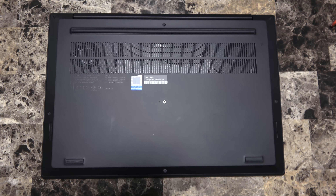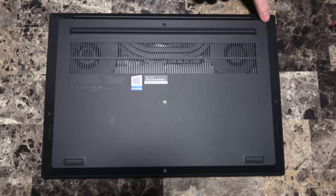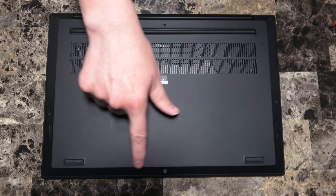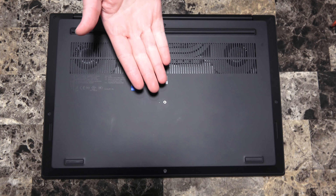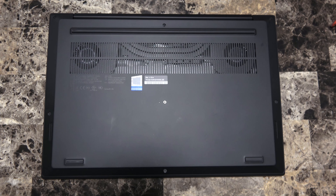Now that the battery has been disabled, we're going to take off the back of the machine. You can see there are seven screws holding this in place — three down the middle, two on each side. I'm going to unscrew those now, and then we'll lift up from the hinge side and pull the back out towards us. There are tabs located all along the front of the backing — you don't want to try to pry those up or force it in any way because those could potentially snap off, preventing the back from being held in place any longer.